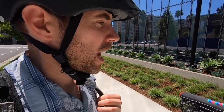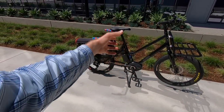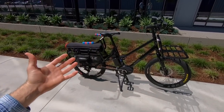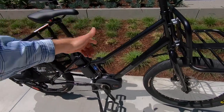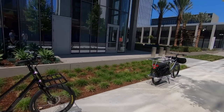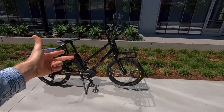This extra welded mount with bosses is specifically designed for the Bosch battery — a little metal chunk inserts into their docking station, which is $250 just for that docking station. If you already have a Bosch-powered electric bike, the 500 and 400 watt-hour batteries are interchangeable with the same mounting rack design, so you can borrow or use them from an existing bike. A whole second battery is $1,100 for the PowerPack 500, giving you about one kilowatt-hour of capacity.